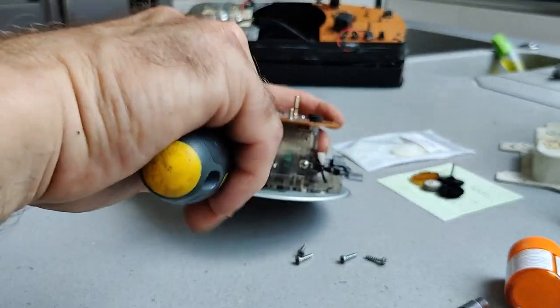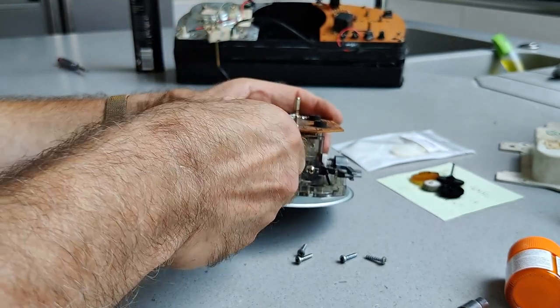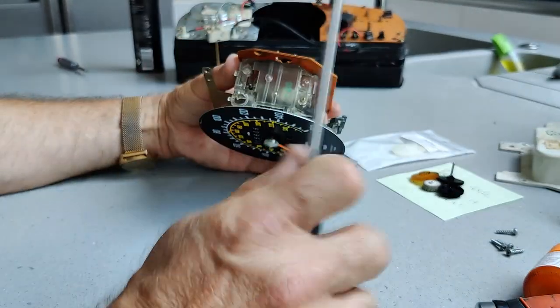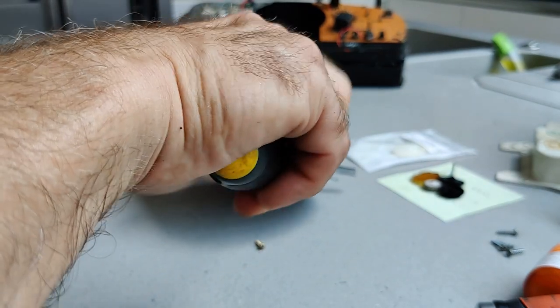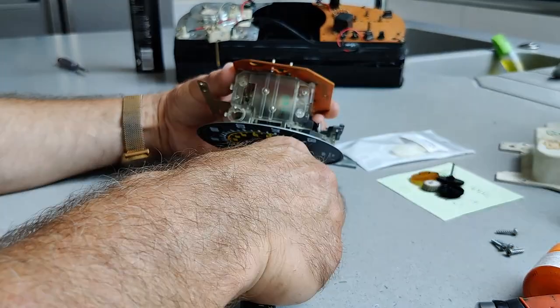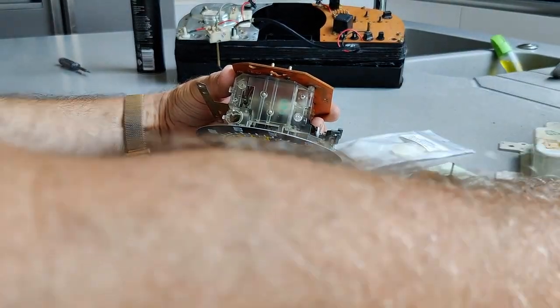If you're replacing these gears, there are so many different combinations of numbers of teeth that you really have to check what you've got first. You can't look it up. Does it depend which model, which year, what final drive you've got? Is it miles or kilometers? What's the maximum speed on your speedometer? There are many, many combinations, not least the model.